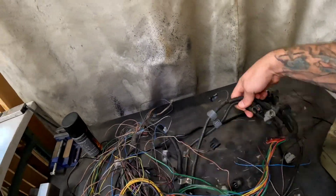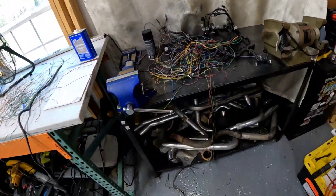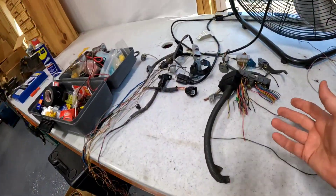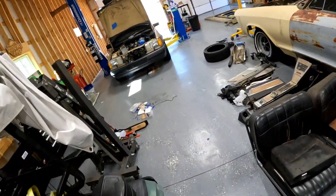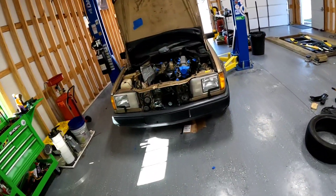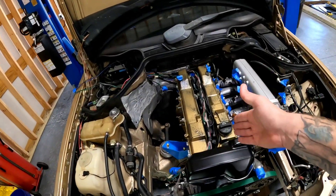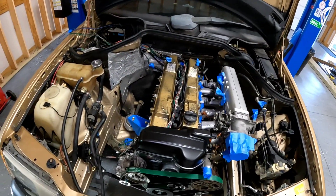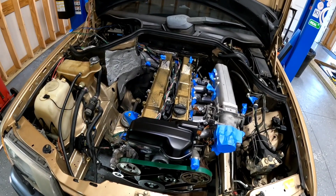I was missing a bunch of connectors I needed for the GTE engine because the GTE uses a mass air sensor and a few other things that the GE harness isn't going to have. Still on a budget — you can see the carnage of the wiring. This was a damaged GTE harness off eBay that I pillaged for everything I needed, and I've pretty much used everything from the GE harness. For about $130, I made my own harness and effectively doubled the length of the stock harness.